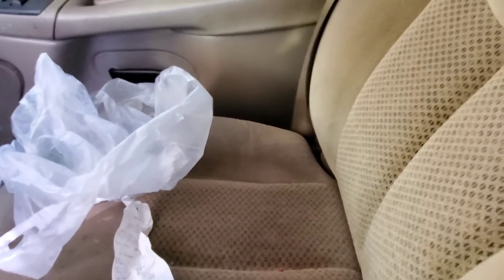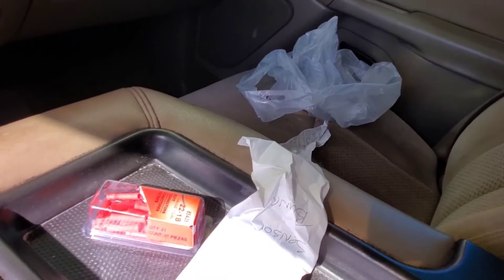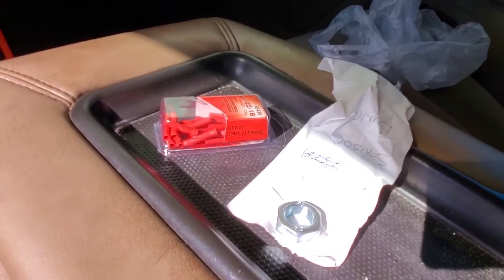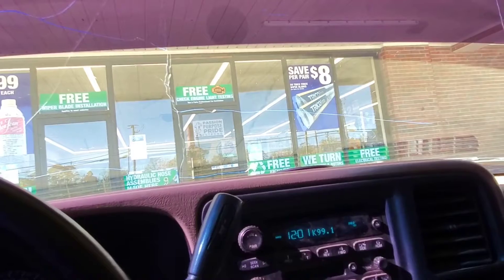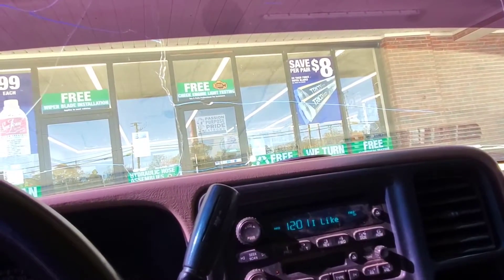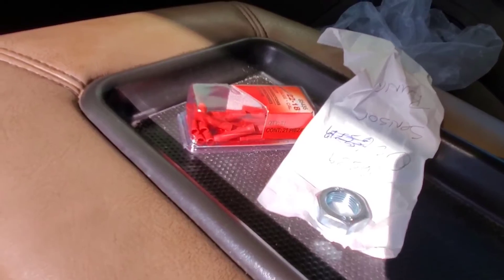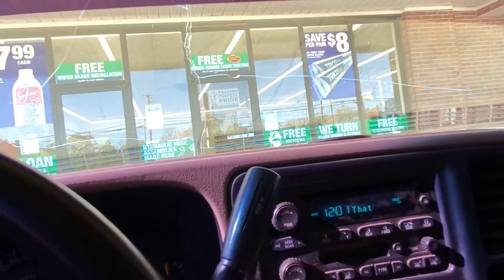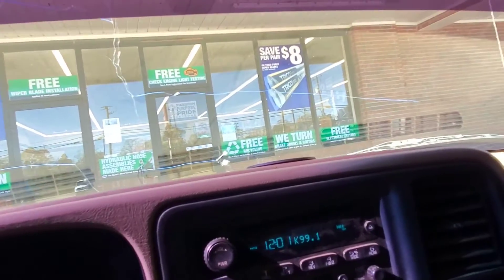What's going on everybody. We had O'Reilly's here, just went in there and got a couple things. Gonna be working on my '92 with the 5.3 today, try to go ahead and get it finished up this month hopefully. I got just some connectors so I can wire up the OBD port so I'm trying to get a tune put on it, and I got an O2 sensor bung here I'm gonna weld in there. The way the O2 sensor bung on my headers is now, when I try to screw it in it basically goes right into the side of the transmission — there ain't enough room to get it in there. So I'm gonna drill a hole and weld this one in there, and that way I can put the O2 sensor straight in from the top and I'll have plenty of room. Gotta run by Walmart and get a couple of odd-in things and then go get started.